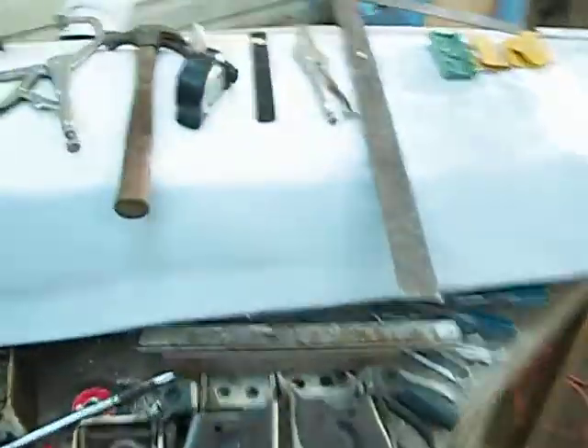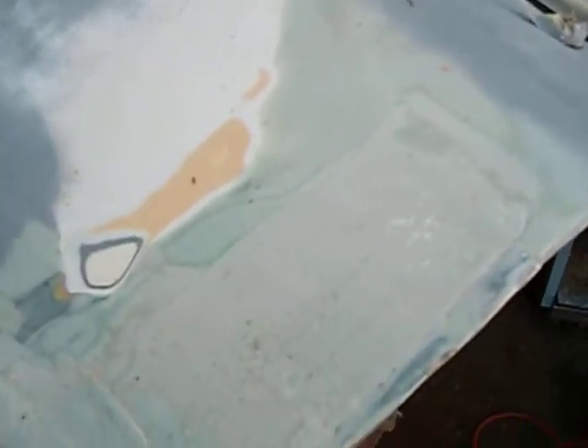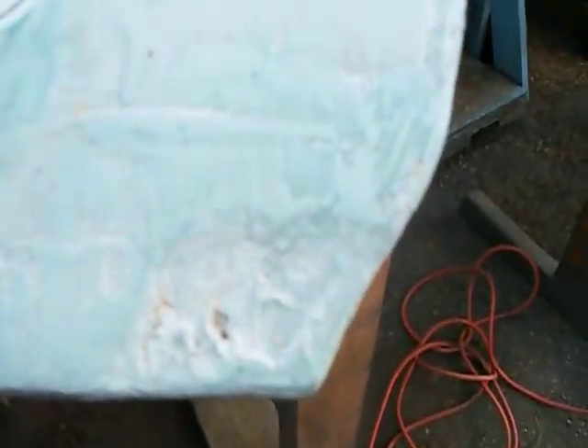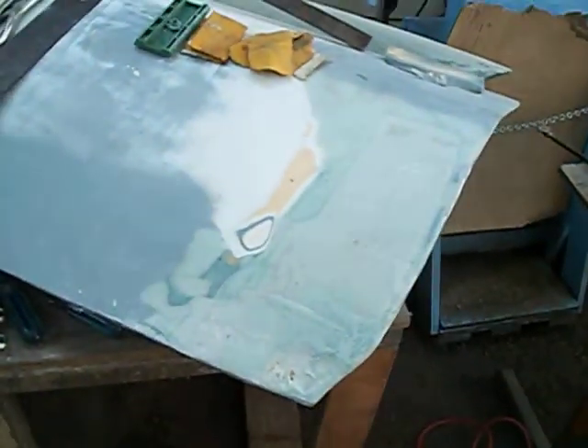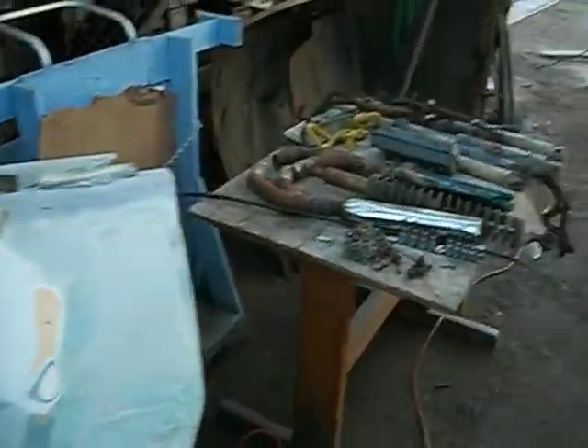I got my other door out here. It's on its second coat of Everglass body filler, but I've got to fix this one edging here — it's a little bit too far in. So I might have to open up this corner and tweak it a little bit. I'm making progress on the Camaro doors.